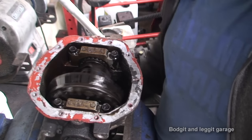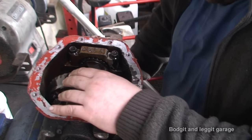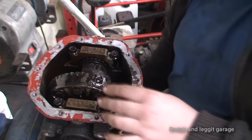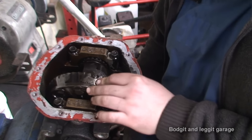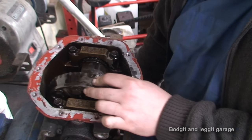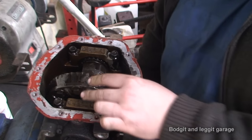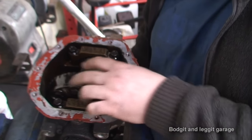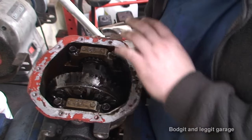For a start, it sounds really really bad. Now there's a setting called backlash — I'm holding the bottom and rocking this. That is way too much backlash. Every time you change gear this goes bang bang bang. You need backlash, but only a certain amount. If it's too tight you'll overheat everything and burn it out; if it's too loose you'll just shatter everything.